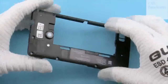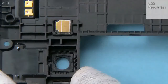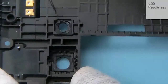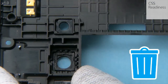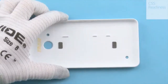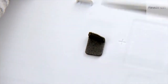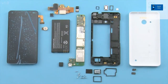To release the LED flash, push it from the back side of the chassis. Turn the chassis over and remove the LED flash with tweezers. Use the dental tool to remove the flash adhesive. Do not use it again — discard it. Detach the main camera gasket with the dental tool. Do not use it again — discard it.